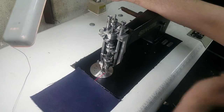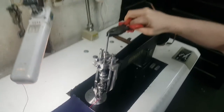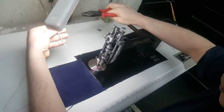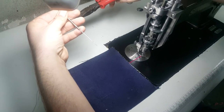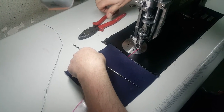I will leave this loose, but check that it is still loose. You will need to lift up your needle bar. I am going to ask you to take it out, completely remove it. You will have a needle on the end — just check that it did not get damaged. We will leave this at the side of the machine for a while while I run through the rest of the machine.